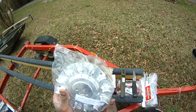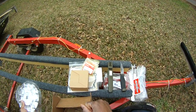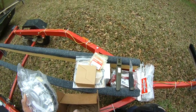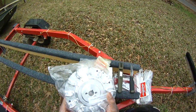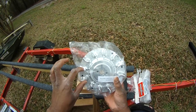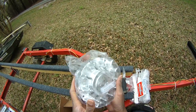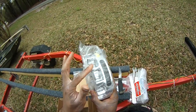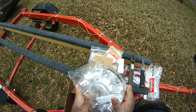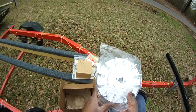Second thing, if you're going to run this billeted flywheel, you need to get a billeted rod, because you need something that can sustain high and heavy RPMs. Now this thing has some weight to it. That's its point. It's the flywheel, designed to sustain that energy. Notice it has fins on here, which is the fan. I'm guessing you can just take the stock fan off, because these are essentially the cooling fins that replace the plastic ones. We're also going to have to buy some lapping compound and various things like that. But there you have it.